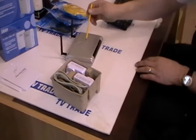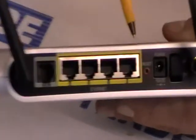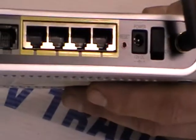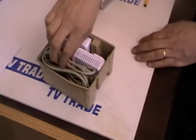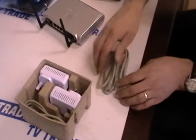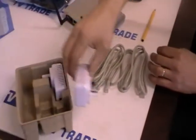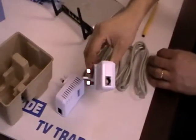So what do we need in this system? We'll have a router like we have here, and if we look on the back there are RJ45 slots - this is where we feed our Ethernet cables in. We'd take a cable from here, feed it to a home plug, and then on the far end have another home plug running a cable to a PC. Inside the box you get a user manual, a CD, two Ethernet cables about 1.5 meters long, and the two home plugs themselves - a three-pin plug with a single Ethernet input on the underside.